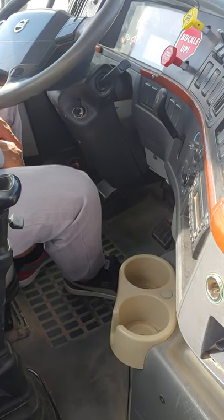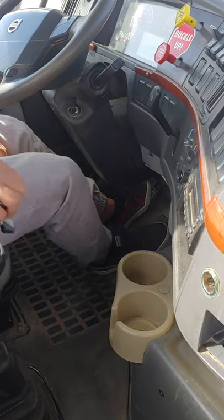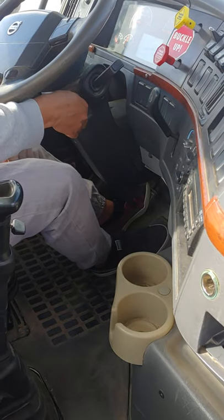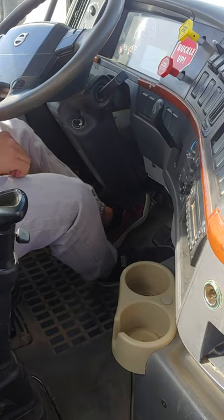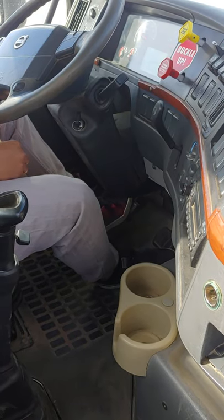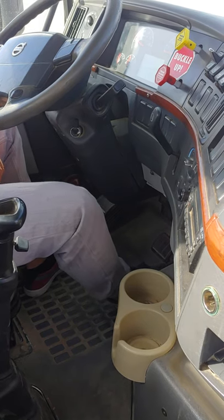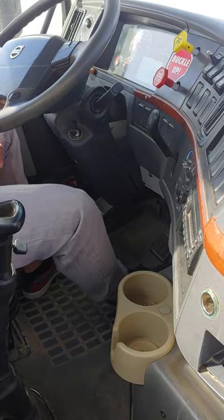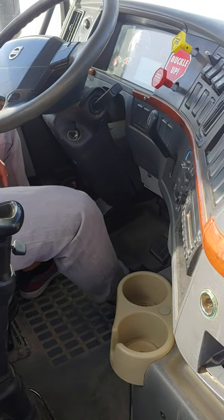I am now going to safety start the truck. When the governor turns off the air compressor, over 140 PSI is not normal.